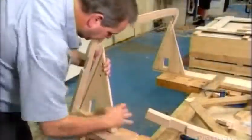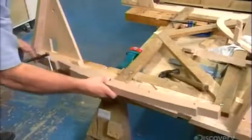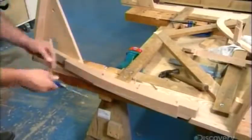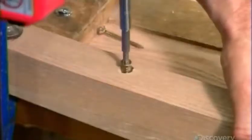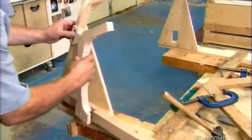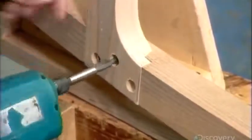They make the frame's front section out of three solid pieces of ash. Triangular wood jigs align the frame while workers screw in a solid ash rail on each side. These rails connect to back framing and form the bottom of the car's door openings. Two vertical rails form the sides of the openings on which the door will hinge.